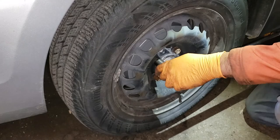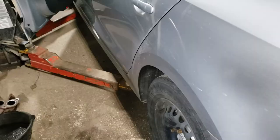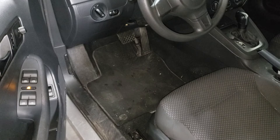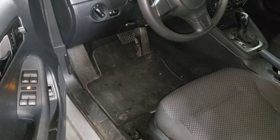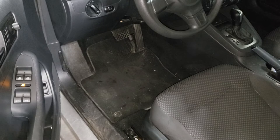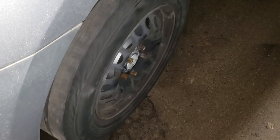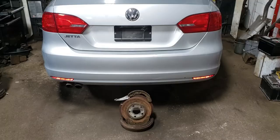Now that you're all done torquing the wheels, your next step is to get into the car and pump the brakes. You want to make sure you fully extend the brake pedal so the brakes will adjust. After that, pull the handbrake, let it back down, and make sure it releases. Then check to make sure your wheels are spinning freely. Then you can go ahead and road test the car. If there are no issues, that's a thumbs up. We are all done with that ancient technology. If you liked the video, please like, share, and subscribe, and hit the notification bell so you never miss a new video. Thanks for watching — see you in the next one.